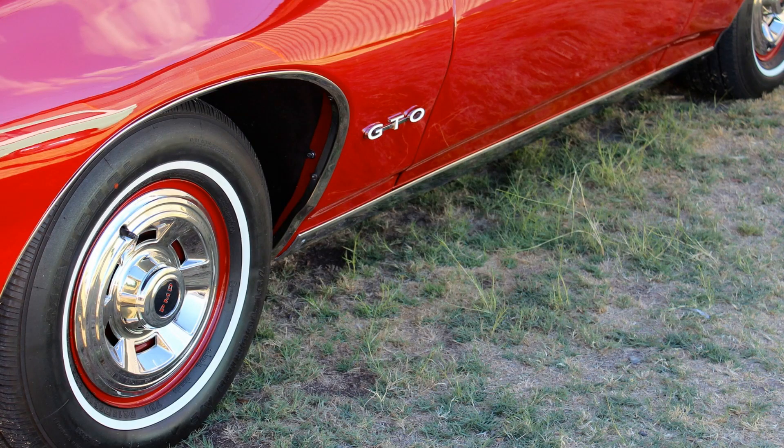Cars shined before they were clear coated. When you went to car shows back in the day or picked up a hot rod magazine and saw these beautiful cars — something like a '66 GTO in Candy Apple Red that just glowed — one of the reasons it glowed is that thing had about 12 layers of paint on it. It was shot, barely sanded, shot, barely sanded, over and over and over. And that's how they got that deep glossy effect from enamel paint back in the day. And guess what? Enamel paint is what we're shooting out of the can onto this hood. It's a primer-paint, but it's white, it's close enough, and that takes care of our priming problem and our stopping-rust problem, because we've sanded all those rusty places and now we've primed it.